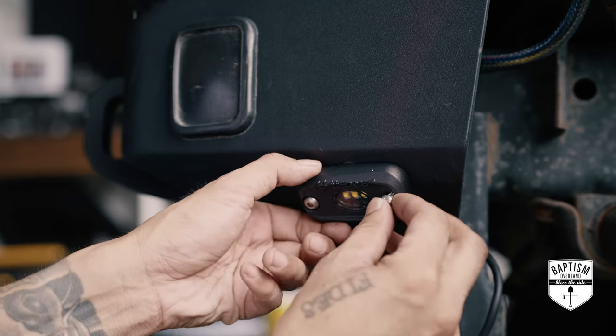And most times when you're gonna be trailing at night, you're gonna need to turn off all of your off-road lights, your ditch lights, your LED light bars. You gotta turn those things off because you don't wanna be blinding your spotter in the face. So all they're really relying on are the rock lights underneath your vehicle. In fact, last minute decision, I decided to take two more ROK9s and add them to the front bumper. And now I have light shining just in front of the front tires because I realized that if someone is gonna guide me through a trail, they need to be able to see what's coming up and where my tire is about to go.